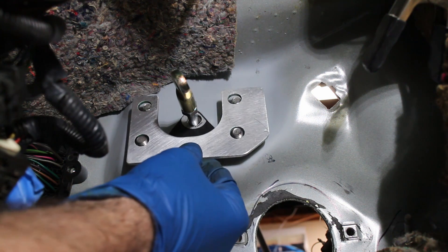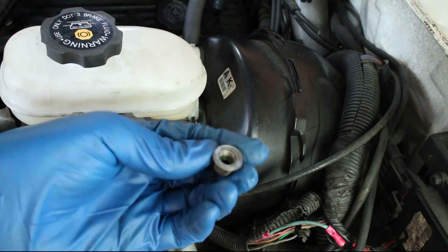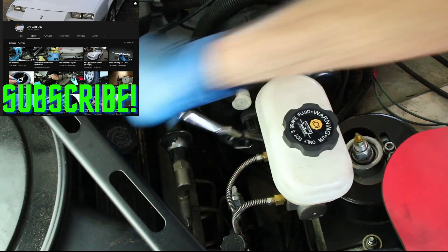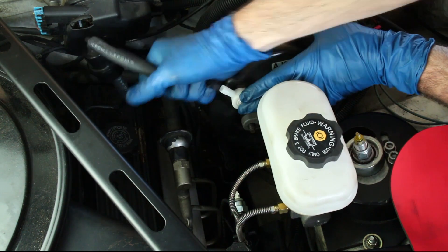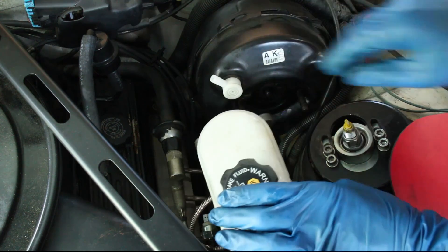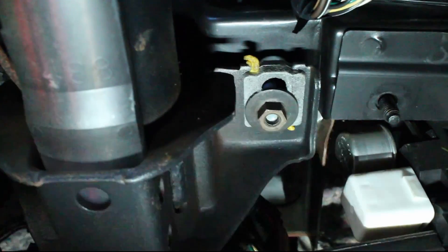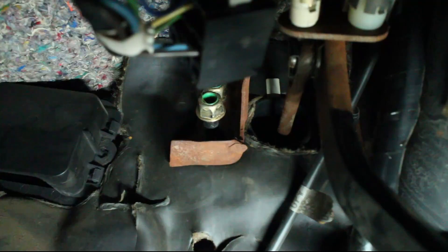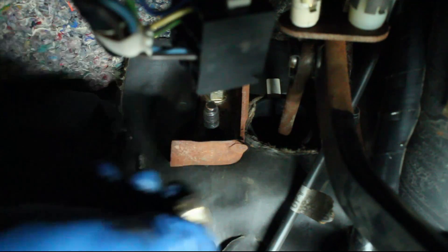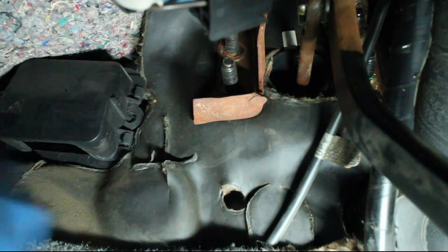The brace goes in between the firewall and the pedal box. I'll be using some older footage for this video. First, we need to unbolt the brake master and wiggle it out of the way. Then loosen the 2 steering column nuts underneath the dash. Remove the 4 lock nuts that hold the brake booster to the firewall. I didn't show removing the last 2 lock nuts because it's simply too hard to fit a camera in such a small place. I did use a few random sockets and adapters to reach the nuts — they aren't particularly easy to get to.